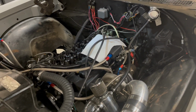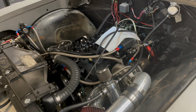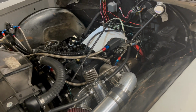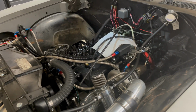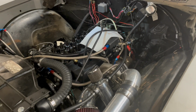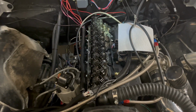So once I get this all back together, I'll try and go over some of the adjustments I've made. It's been a lot of fun tuning everything. It's been quite a learning experience, especially with the progressive throttle linkage, because the amount of extra air that the secondaries let in really threw everything off. And honestly, for the first 600, 800 miles, I wasn't even using the secondaries. That's how big this throttle body is. And I could get up to 6, 8, 10 PSI just fine. It might have just come in a little slower, but other than that, thanks for watching, guys.